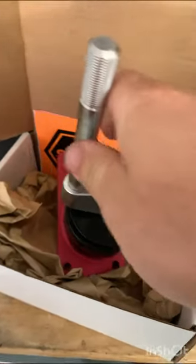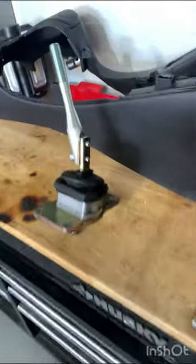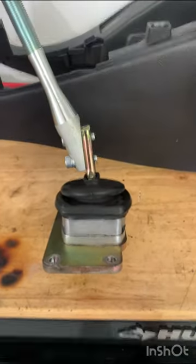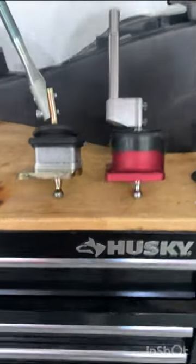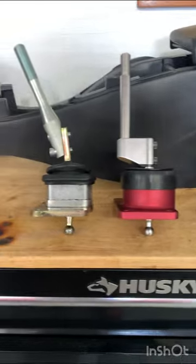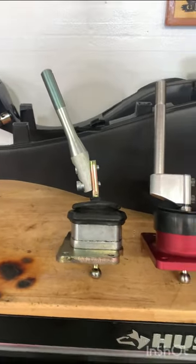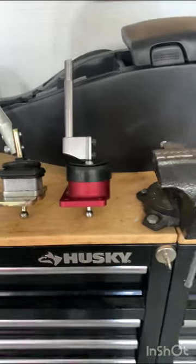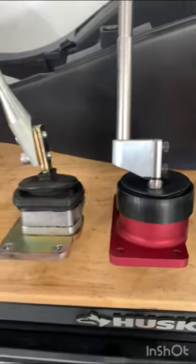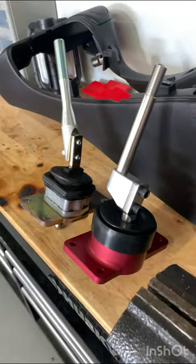It's pretty nice, pretty well made, and pretty light. That's the factory Hurst shifter with the UMI short stick on it, so you can kind of see the difference — the shifter stick is off-centered and I didn't really like that. The Tick one looks pretty nice. It says the spring engagement is pretty quick, so I'm about to install it and take it for a test drive.